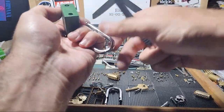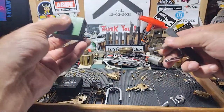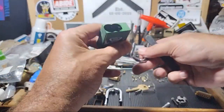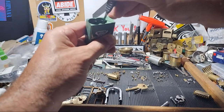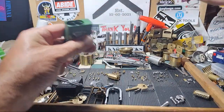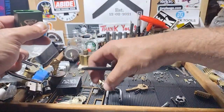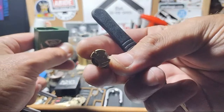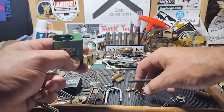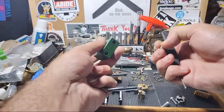I'm just wondering if there's something in that actuator, because I never took it out, but by taking out the shackle, if somehow that made the actuator turn. Because if that spun, then it might not be taking the ball bearings in place, if you know what I mean. On the other actuator, if it's turned like that, the ball bearings slide into the sides. If it's turned like that, the ball bearings don't fit in. I do not want to start losing these again. I think that may be the problem we're having here.